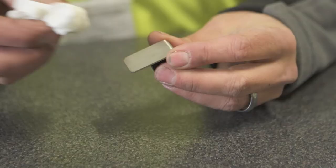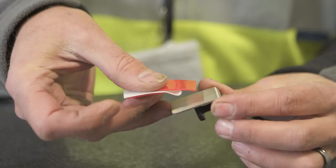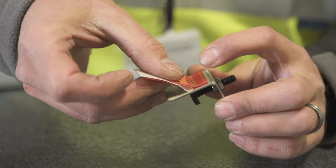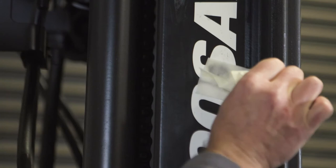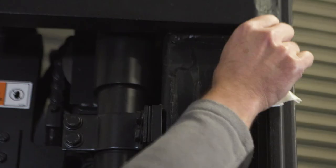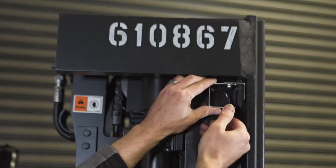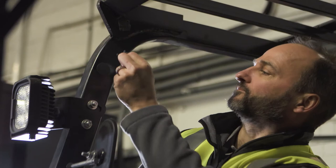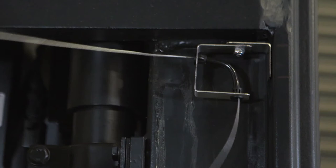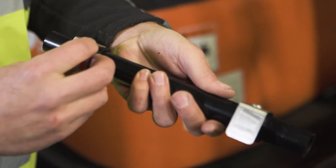Avoid touching the clean surfaces. Dry the cleaned areas of each bracket and replace each adhesive pad with the permanent red adhesive pads provided. Press the permanent adhesive pads firmly onto the bracket surfaces. Use the alcohol wipe to thoroughly clean the areas marked during calibration, and again check that the surface is within the ideal temperature range of 20 degrees C to 35 degrees C for the permanent pads to adhere correctly. Reinstall the cable guide and cable adjuster in their marked positions, pressing firmly to ensure a good adhesive bond. Feed the cable and indicator weight into position and secure using the cable stop. Now reinstall the guide tube using your markers on the mast.